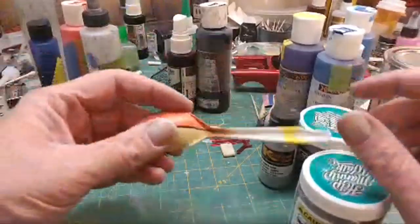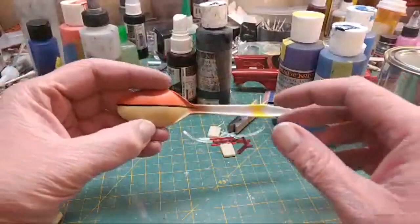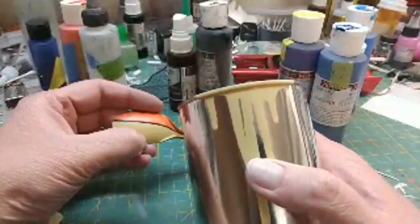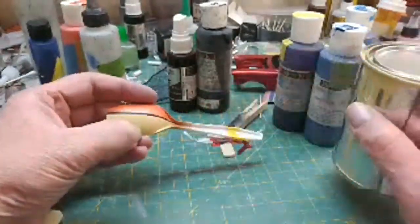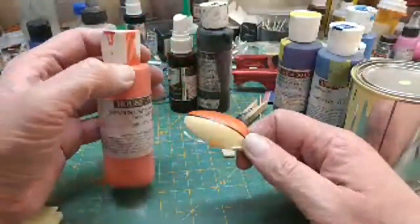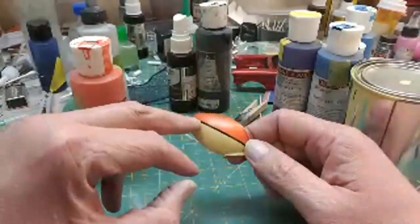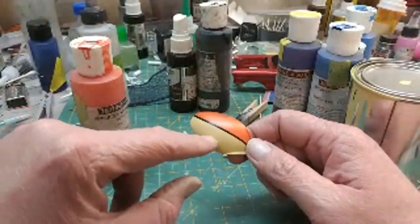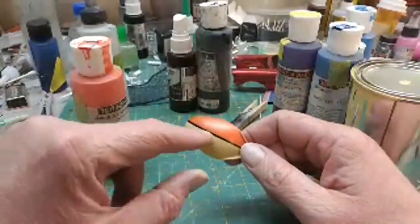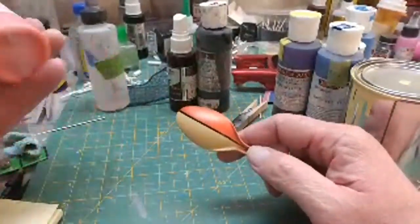For the Peterbilt, I don't know if you guys can see this real good. It's like a yellowish cream, and I added a couple drops of House of Color Tangelo to the cream, so it has a little bit in it. I'm going to shoot the black first, then the cream with a little Tangelo in it, and then shoot the Tangelo on top of it. So it's all going to be masked back and forth. It's going to be a little neat. Hopefully I have enough for it.